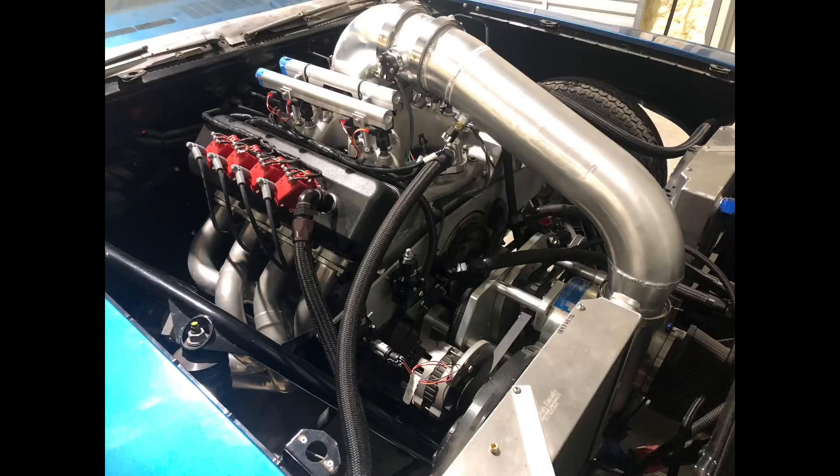There are a couple other things we're going to change, like add some seat belts, probably change the seat, maybe put some electric windows — as the customer wants to do that. But as far as the engine, it's pretty much everything ready to go. We converted it from a carburetor blow-through to EFI — it's a big block Chevrolet — with a new charge pipe, coil-on-plug, you name it, all the works. I've been staying pretty busy on that one.